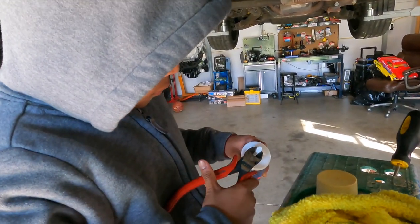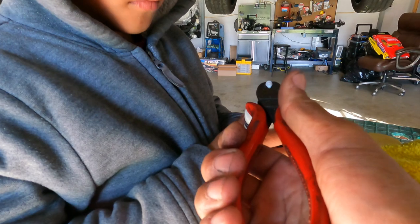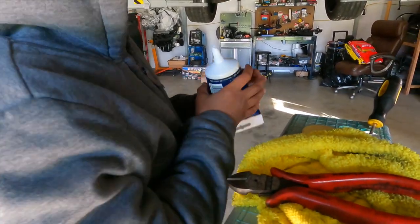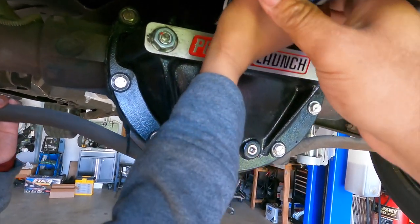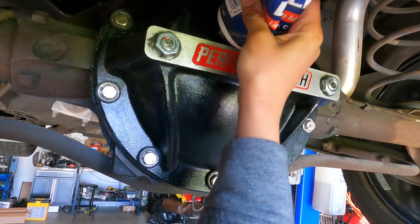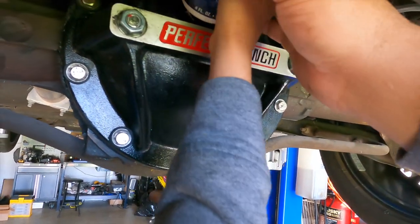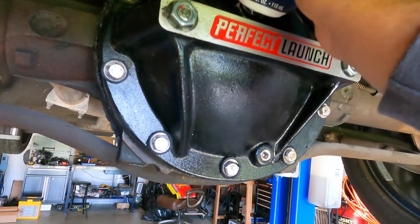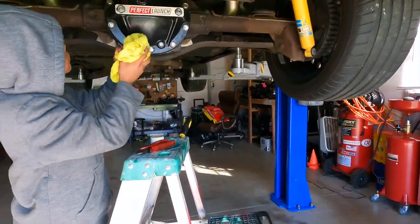Go up the ladder, snip it right at that line up there — can you do it? Hit it with the cutters, you got it. Here, let me cut it for you — I don't want you to spill any of it. Now see if you can stick it in there. All right, squeeze it — there you go, get it all in there without spilling it, that's the goal. You always want to put your Slip Lock in first, then the fluid — it's four fluid ounces. You don't want to forget to put it in there and then have all this mess with the posi unit.